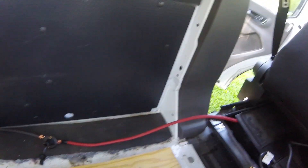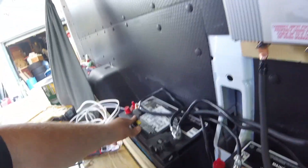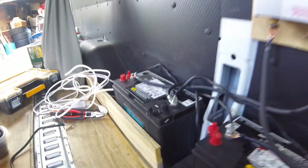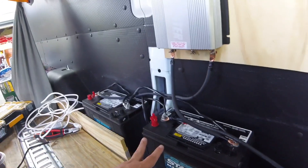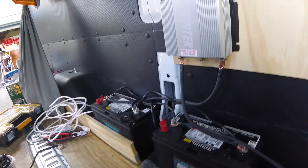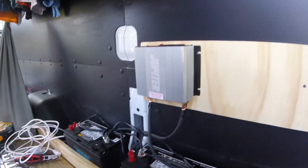This is all wired up. Got your positive coming from the start battery to your on-off switch, positive running from the on-off switch to the first battery positive. Then we got a negative going from negative to negative on the batteries, positive going positive to positive on the batteries. Got the inverter negative going to this battery and the positive going to the furthest battery on the positive. The system is grounded right here to the frame of the van — that's what they call parallel. So it's a 12-volt system still. These are 100-amp-hour batteries apiece, so it's 200-amp-hours, which discharge-wise you only get around 50%, so it's really only 100-amp-hours truly. But these are deep-cycle marine batteries, listed as 100-amp-hours apiece.